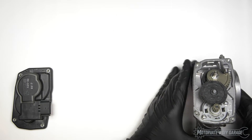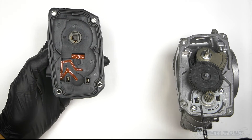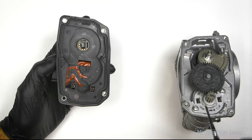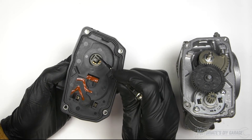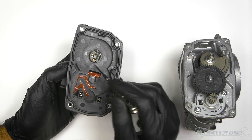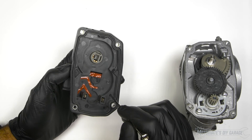Let's look at the cover. Not much interesting on this side, so we'll flip it over. Here we can see two little electrical connectors that provide control power to our small DC motor. Here we have the throttle shaft — it's got a flat spot and another flat spot — and this throttle shaft goes right inside here. As the throttle position changes, so does this, and this is the actual throttle position sensor. In behind here are two variable resistors, and the resistance will change depending upon the throttle position. The last thing to point out is this nice rubber seal that goes all the way around, which ensures any water and dirt do not get inside our throttle body.